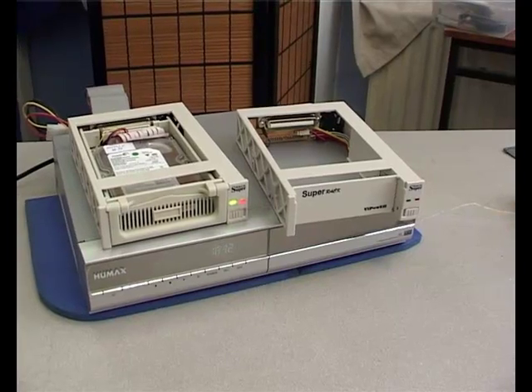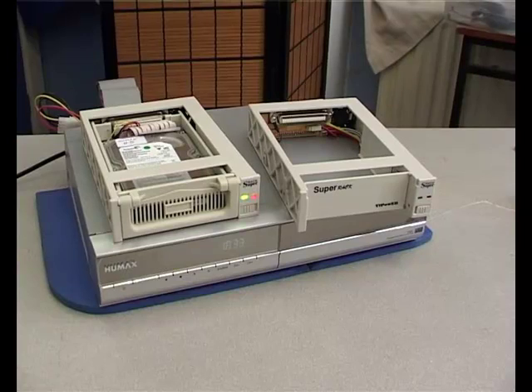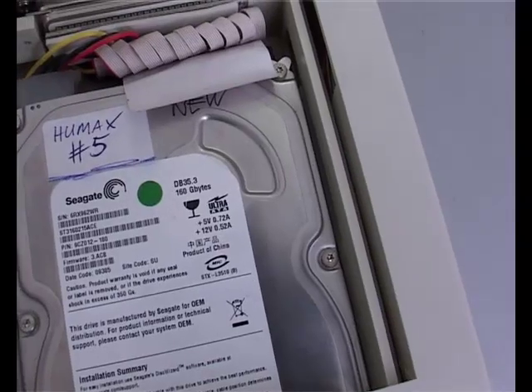You would be able to install a second drive carrier and put it into the computer, either inside the computer box or using a USB to IDE converter gadget that makes it work like a USB external drive. You can take the drive tray out of the Humax drive tray and put it into the computer drive tray. There's a piece of software you can get off the internet called 9200T Read Files .exe, which lets you read files from the Humax disk. You can then transfer them onto your computer to archive or edit them, freeing up space on the Humax while keeping a library on an external USB drive or similar.